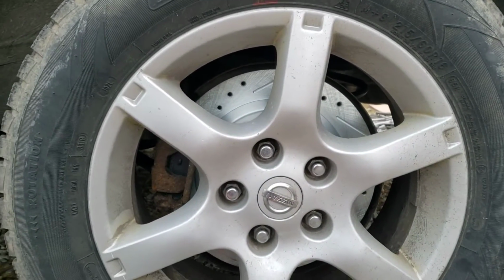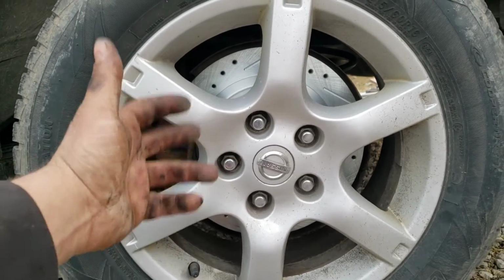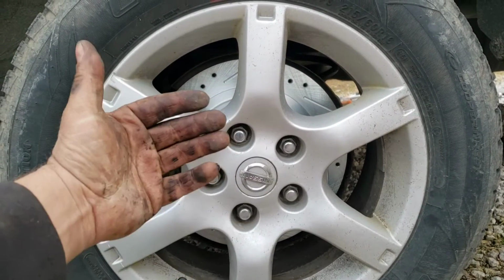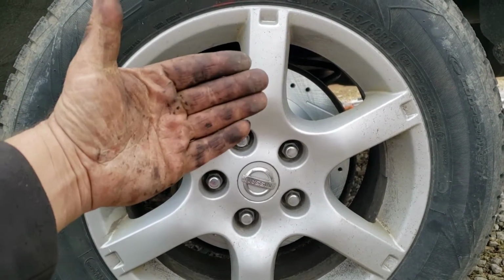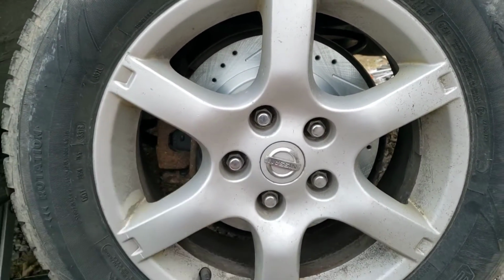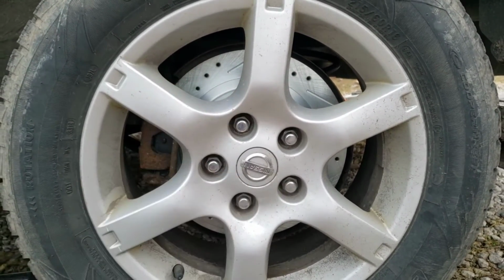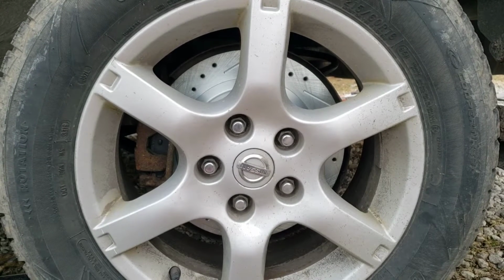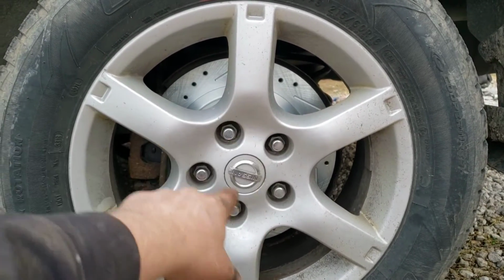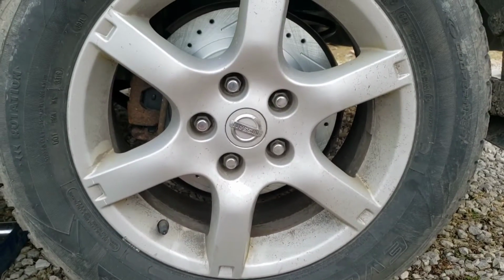When you put brand new brakes on, this is actually really important. It's a common misconception, the warped rotors. That's actually how you get warped rotor symptoms. If your wheel doesn't go on perfectly flush and it's cockeyed, then that'll allow your rotor to wobble because it's cockeyed also. And it'll wobble in between your pads, and that's how you get hot spots. And that's how you get that pulsating warped rotor symptom in your brake pedal. So if you don't want that to happen to your brand new brakes, then I highly suggest you torque in 3 or 4 steps in the crisscross pattern, and without the full weight of the car on it.